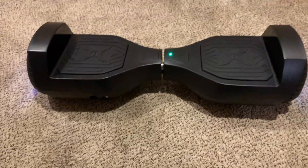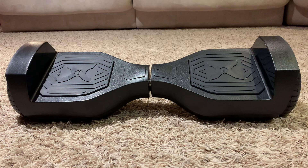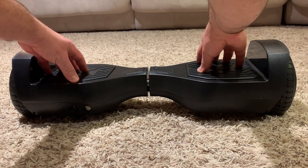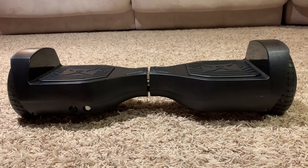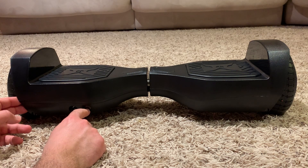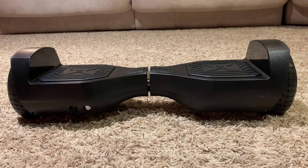Without it dragging on the floor, so we need to get it recalibrated. To calibrate your hoverboard, start with the hoverboard placed on a flat surface with the hoverboard off. Manually level your hoverboard so that it is level on the flat surface — this manual leveling is the actual calibration. With the hoverboard off and leveled, hold the power button for 10 to 15 seconds until you hear beeps from your device. This can vary based on model.